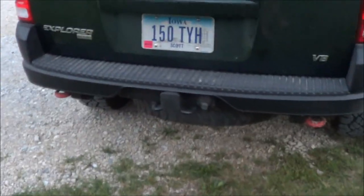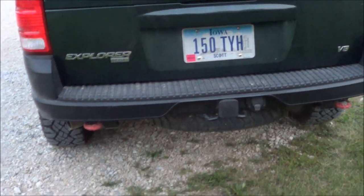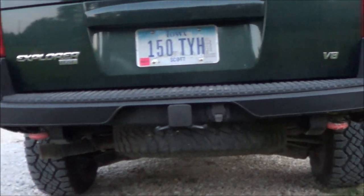What I did first off was I came in and pulled the bumper cover off, which is pretty simple. There are plastic push pins and bolts and stuff under the taillights. You pull all that off and there's this hard foam underneath that has to come out as well.